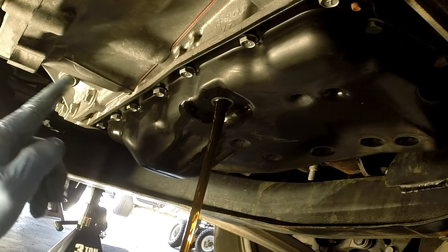It's important to have the car up on jacks both front and rear and it needs to be level, or this method of equalizing the fluid won't work and the transmission won't function properly. Looks like we're done — it took exactly four and a half quarts, which is about what I expected. I ordered five quarts and the transmission looks good; I'm very happy about that. Everything now just goes together in the reverse of how we took it apart.